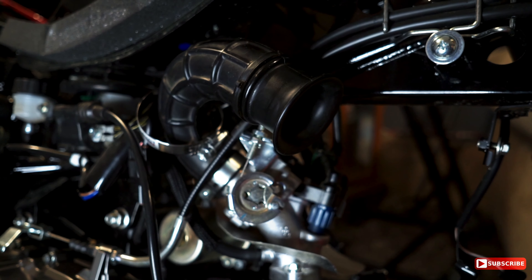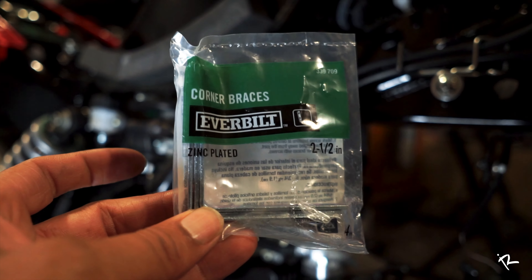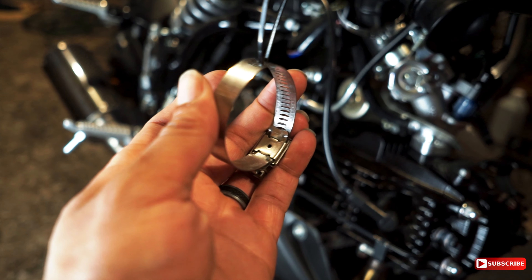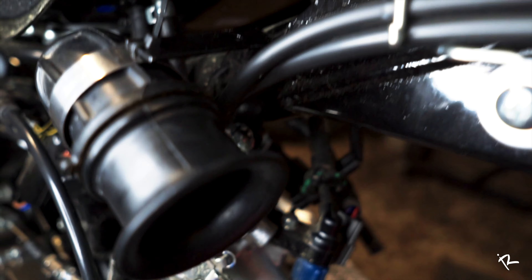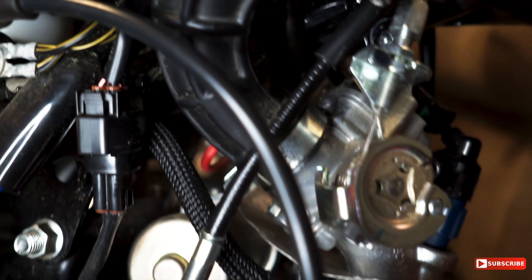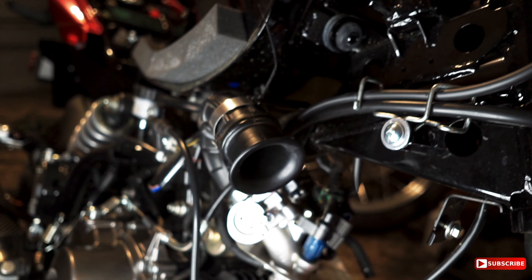What I'm going to do is build a bracket to hold that hose in place. I'm using some of these Everbilt two-and-a-half inch corner braces — I painted them black so they're less likely to rust — and I'll be zip-tying this hose clamp to the end of it. So this is my homemade bracket: I got the clamp right there and it's mounted back behind this with a screw. This black mount right here goes down and it's screwed in right there.